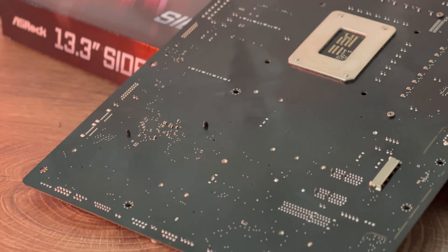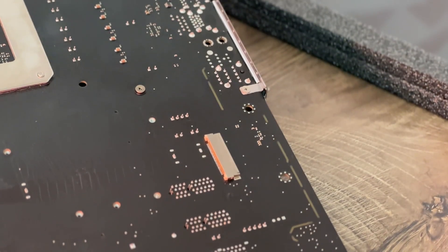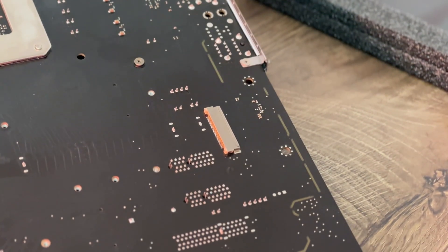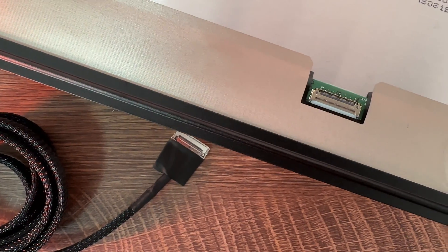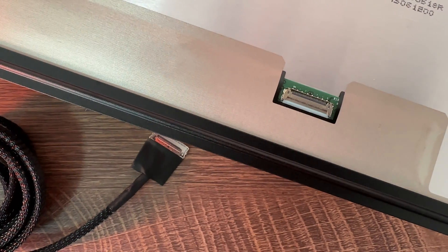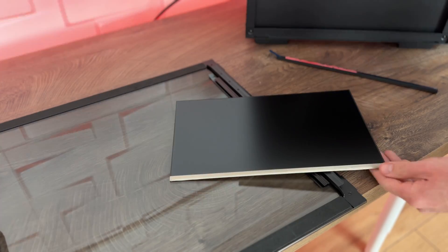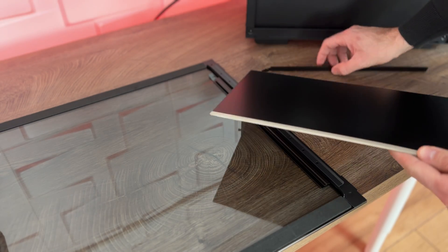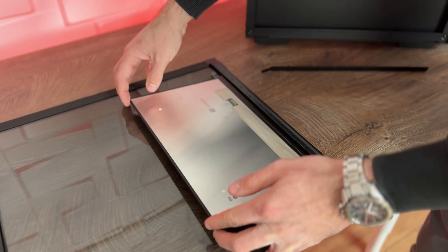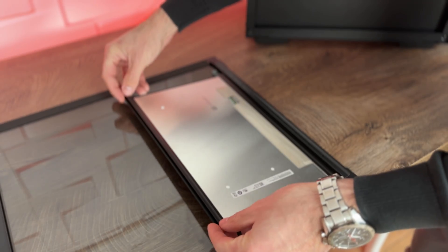It's fairly easy to do everything, but most importantly you need to attach the E-DisplayPort cable at the back of the motherboard before placing the motherboard inside the case. After that the steps are quite easy — you place the bottom bracket first depending on whether you're going horizontal or vertical, because you can go with both positions and it's all up to your liking. I decided to place it like this just so you can see that you still have loads of space inside the midi tower case where you can actually see your build.